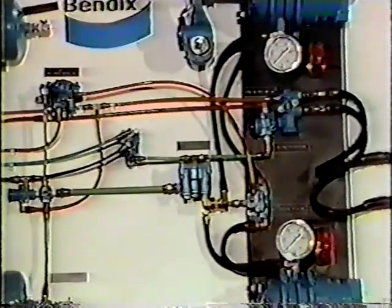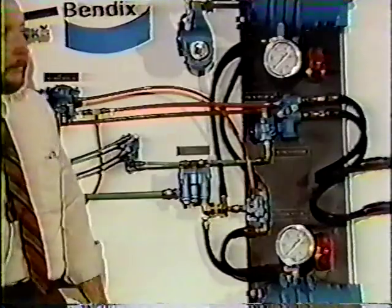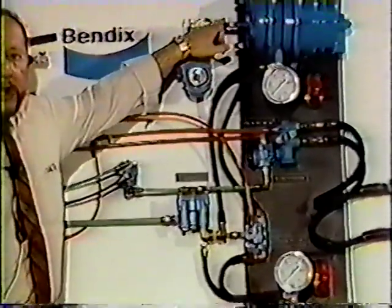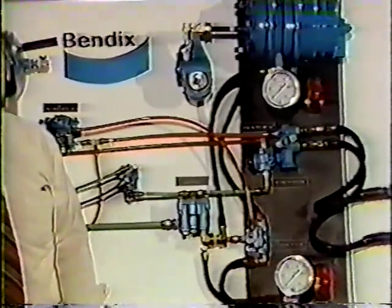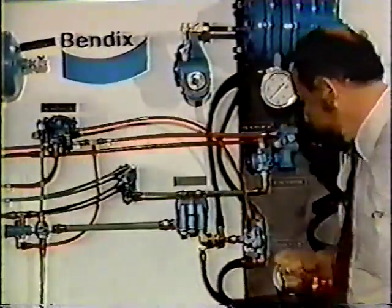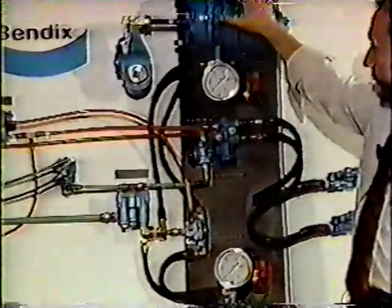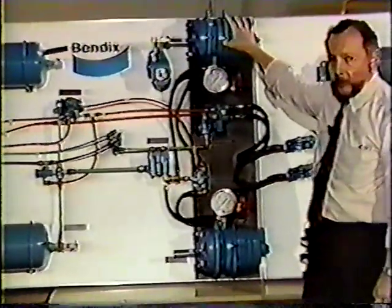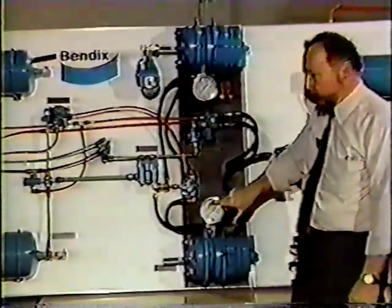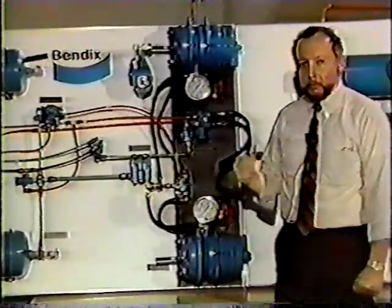Now what happened back here were both needles moved up at the same time, and the push rod didn't move in or out. That was a demonstration of brake anti-compounding. Before I explain how it happened, let's just think of what actually did happen on the rear axle. When I forced the foot pedal down, I sent air pressure into the spring canister. You saw this needle move up. That compressed the spring. Air in here, the brake came off.